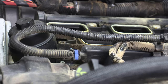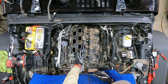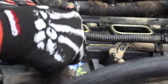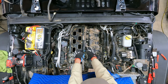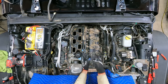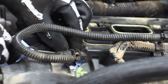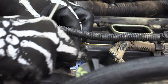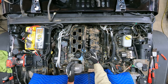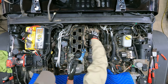I'm going to try to take the lower intake with the fuel rails on it, so that means unplugging the fuel line. I'll put a rag under the fuel line just in case we get a little gusher. We gently release the blue clip — clip is off — and we should be able to get the line off now. There was a little bit of a spray, nothing dramatic, and the fuel line is off.